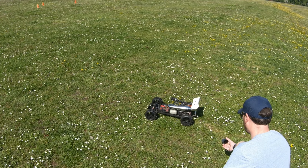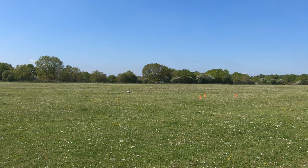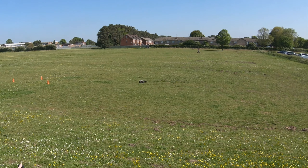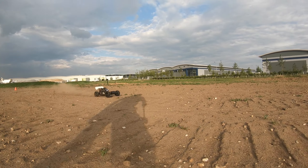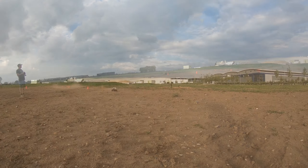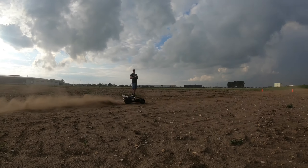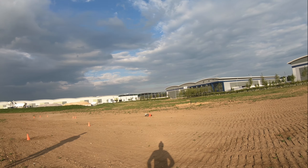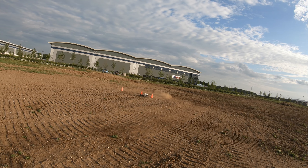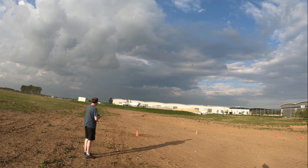Clutch-wise, engaging it, it accelerates nicely and we get a decent amount of wheel spin. This is on grass — quite bumpy long grass — but it runs quite well. Here we are running on the dust and it actually runs quite well on here too. Again, that rear suspension's too stiff — you need to look at that. And of course it slides about; you need to keep on the power a little bit more and keep the engine spinning up. Without the body shell it does get rather dusty, so we need to try and address that.